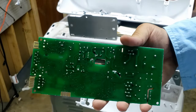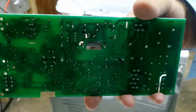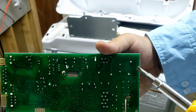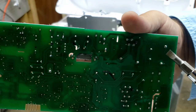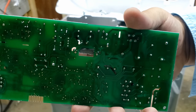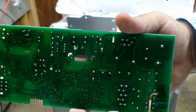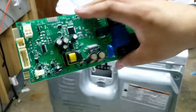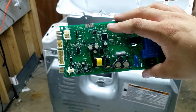There is no damage here on any of the pins, so use this as a reference. Typically you're going to find most of the damage right approximately in this area — sometimes you'll see burn marks, or you may find one of these small solder points totally desoldered and needing to be put back in. You can either replace the entire board or learn to use a soldering gun and get these re-soldered. Typically the relays are pretty cheap and you can fix these boards for under ten dollars using a solder kit, or you can decide to just replace it — but you may spend anywhere from $150 up to $300 to replace the board.